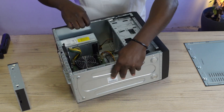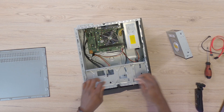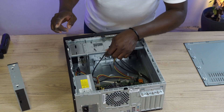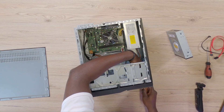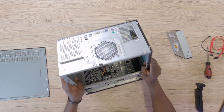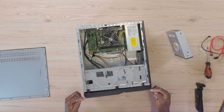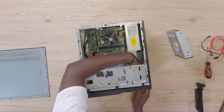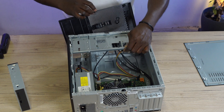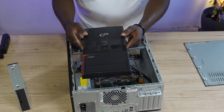Just to put it out there, try to be careful. Go ahead and take it gently by raising the clips a little bit. There is one more clip hiding inside — a lot of mistakes I find people making is they open the outer clips without disconnecting that inner clip. As soon as that clip is released, the cover comes out pretty easily, and that's the front cover of the Fujitsu PC.